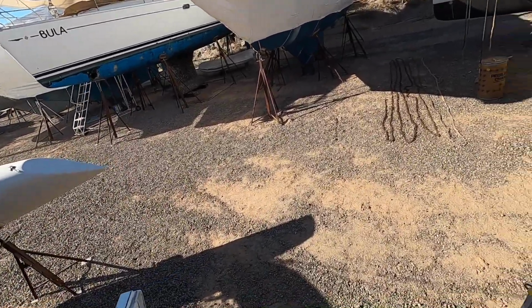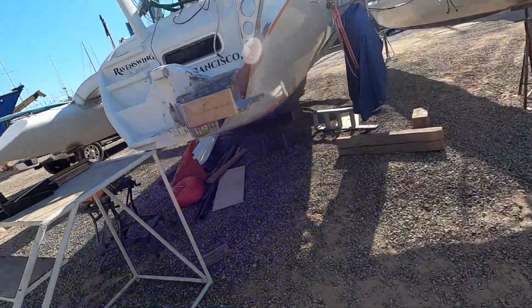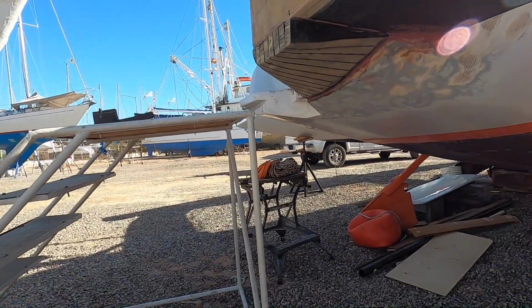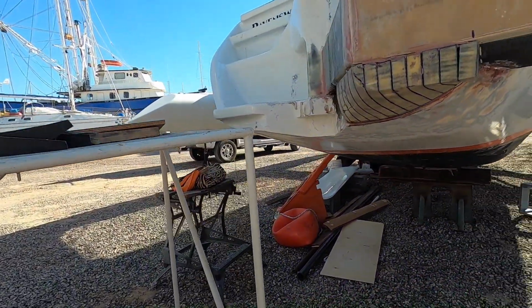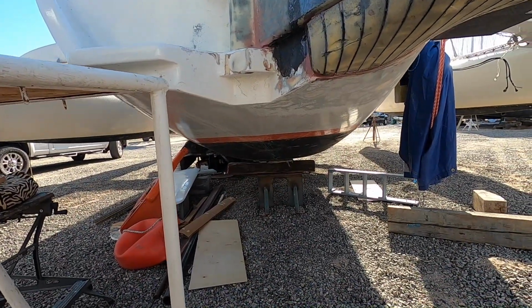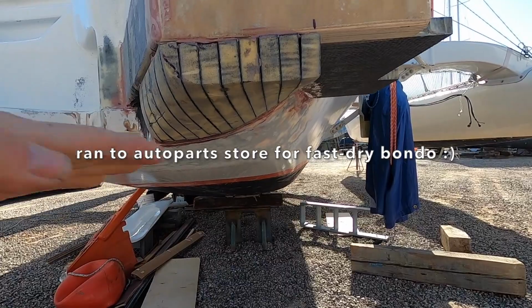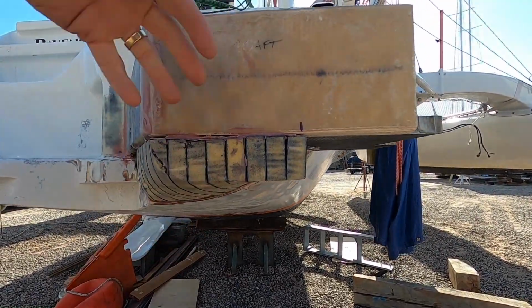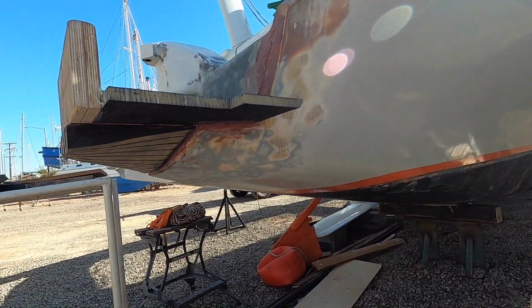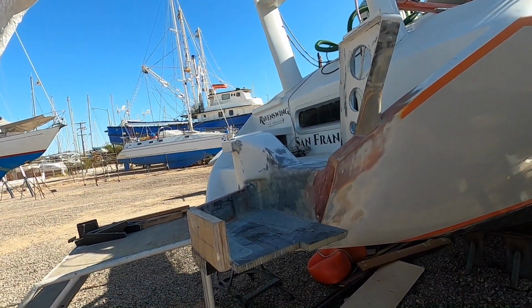And let's go check out the underside of the motor mount. See how that thing came out. Really happy with the shape. You can see the curve matching to the hull. All these twists, pretty interesting. A little bit of damage with the digging too deep with the oscillating saw, but we'll fill that in before we get the carbon uni on this. So carbon unidirectional coming this way, create like an L bracket of support. That's today's job. Okay, that's the update.